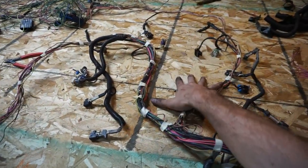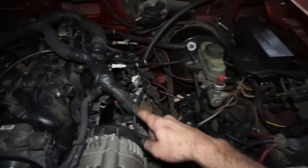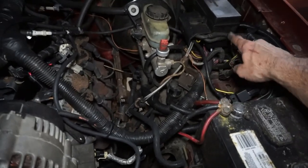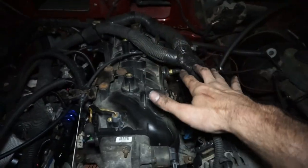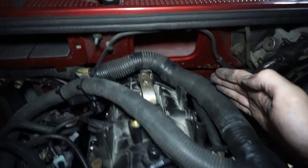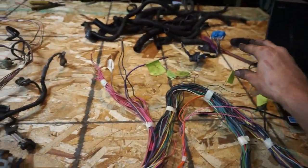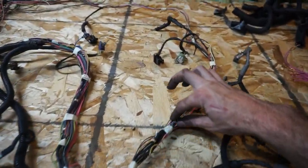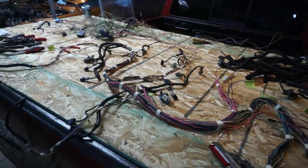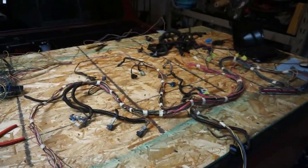One thing to consider: this harness is basically designed to have your intake here and a big bundle going over to the power source and computer. I didn't like it that way on this truck, so basically I have just the power sources - ignition 12-volt positives and signal wires to the gauges - coming over here, and then all the PCM wiring flipped over the top and running back over through the firewall. You can be creative and do whatever you want. That's a basic DIY standalone LS swap harness. Thanks for watching.